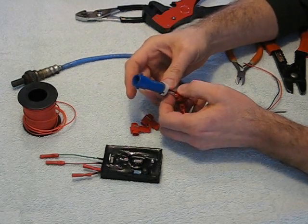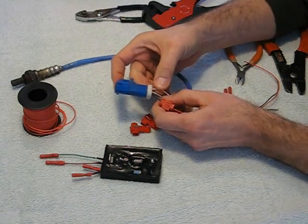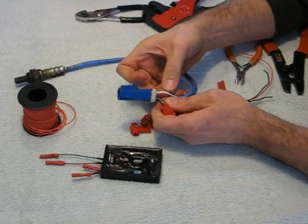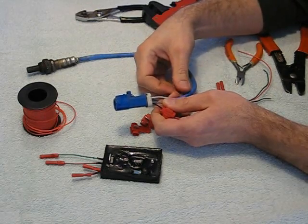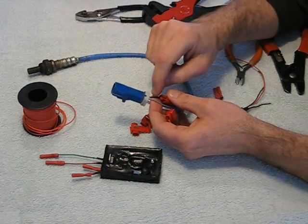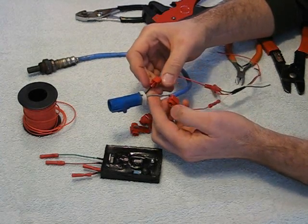You'll inspect the wires. Usually you'll have four wires, and two of them will be the same color — these two are white. That's the heater supply lines for the O2 sensor; we don't have to worry about those. The other two wires are for the O2 sensor signal and O2 sensor signal return. We only need the O2 sensor signal wire, and that's the one that will fluctuate between 0.1 and 0.9 volts.